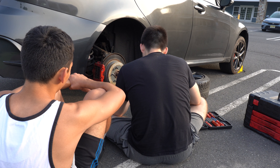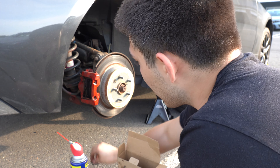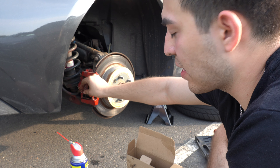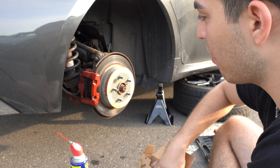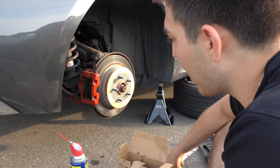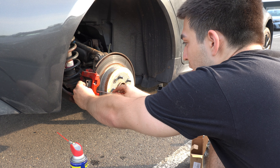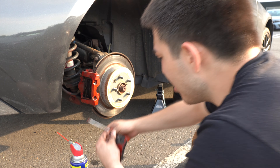To get the caliper off you have to remove the pins — there are some springs you just pop off. There's a hole they attach to and you pull them back and they come off. Then there are pins up here you pull back as well. I grabbed on and pulled to push the brake pad out. The brake pad is lodged in there — just stick a flathead and push it out.